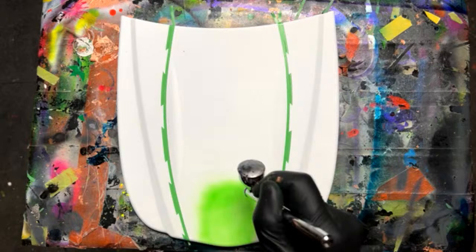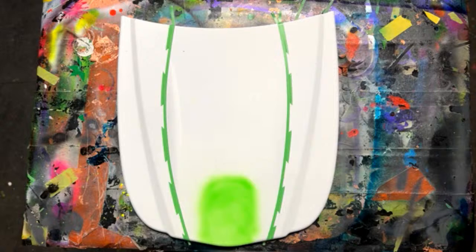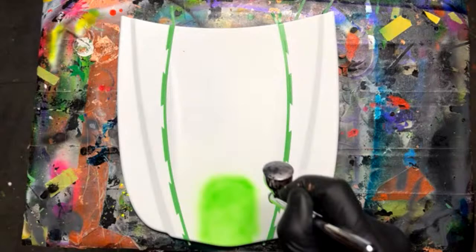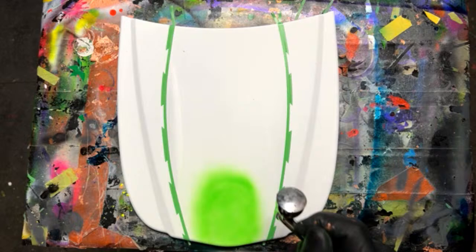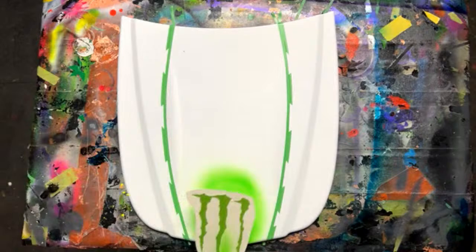Someone just has a question. They said, when you're spraying the glue for leaf, do you adjust the pressure on the airbrush? He's having issues with the glue puddling up. Yeah, so you're going to want to spray the glue really thin and really light, in light layers. If it's puddling up, that means you're putting down too much at one time. Or you could be thinning it out too much. That's probably not the case, though. You've got to put it down thin like you would a tack coat. At no point should it get wet to where it stays wet. It pretty much is applied dry. Okay, looks like that's going to do it. Get those edges a little bit.